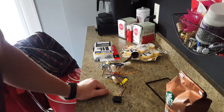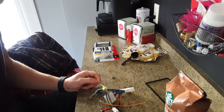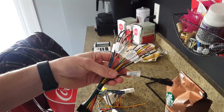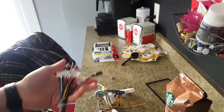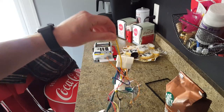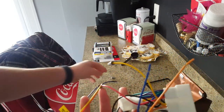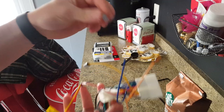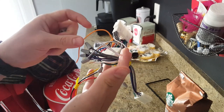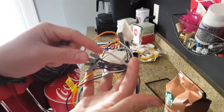I'm inside now because it's a little cold outside. I'm going to be separating these harnesses and hooking it up to the new harness for the new radio. The new one is a lot more complex — there are steering wheel control plugs and things like that that aren't going to be used. I'm going to use wire nuts just for testing purposes — this is terrible, as you can see. Do not use wire nuts to install your stereo permanently, but I'm going to use them just to test.